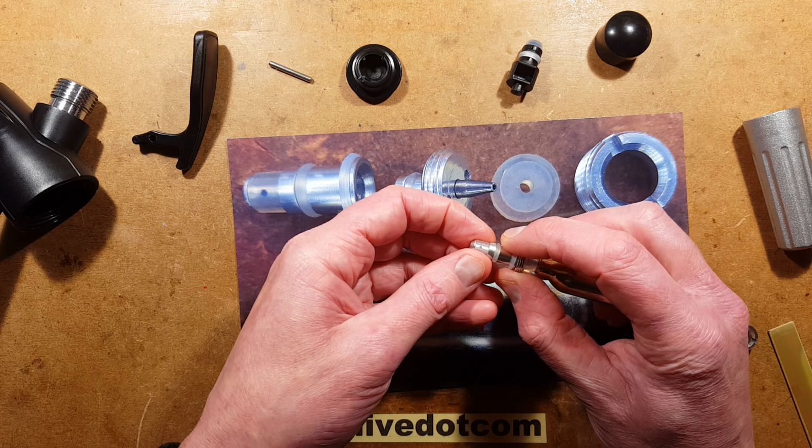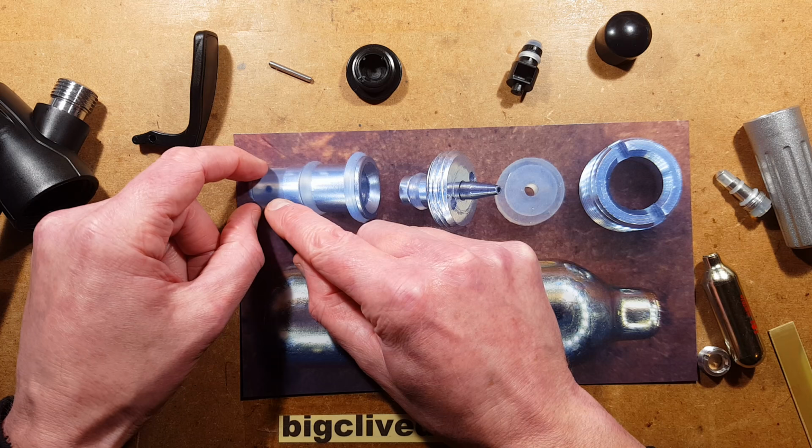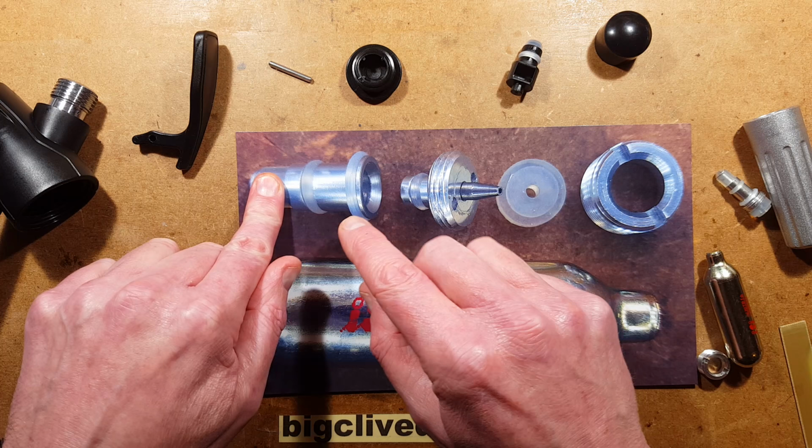And what happens there is that because of the major pressure differential, it actually blows this sort of tube, it sort of opens it a bit out the way as the gas escapes underneath it. And then once the pressure equalises, that tube then sits back down. And when you remove this cylinder from here, the internal pressure in the soda siphon then pushes that shut and it stops the gas getting back out. It's a very, very simple one-way valve.